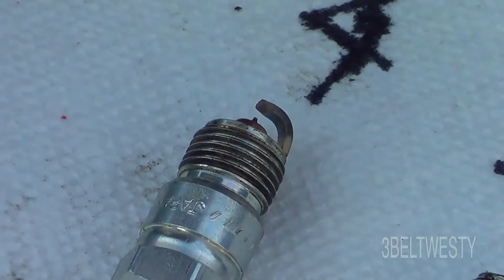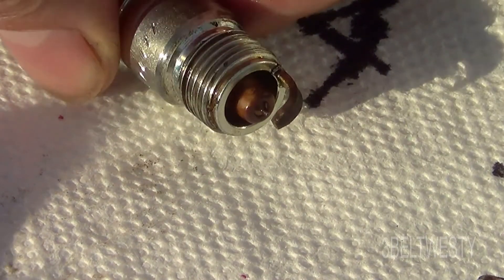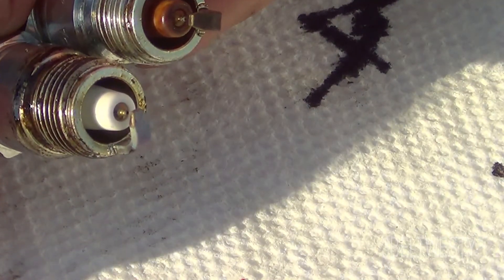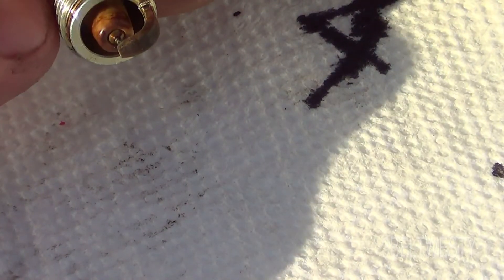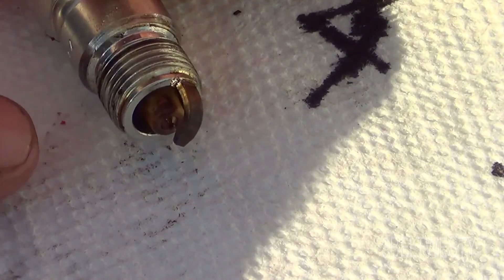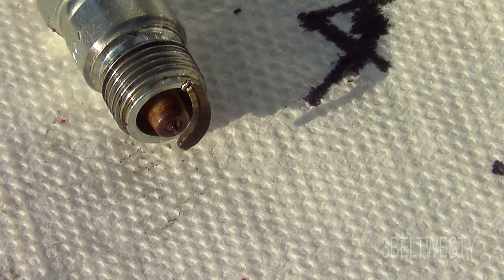The iridium plug really didn't magically fix anything. That was a brand new plug I put in, and it's already fouling. As soon as it starts to misfire, you get unburnt fuel going through the exhaust manifold, which probably screws up the air-to-fuel ratio because the oxygen sensor may be sensing that. Then it combusts back in the converter and muffler area, causing that popping noise.